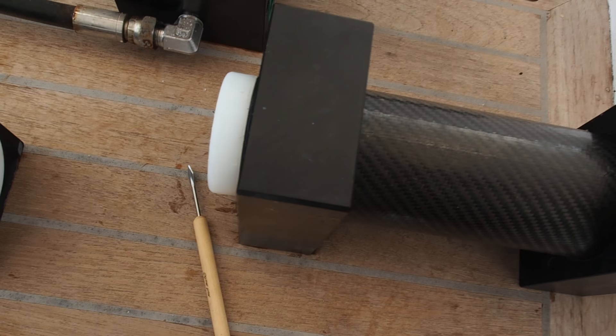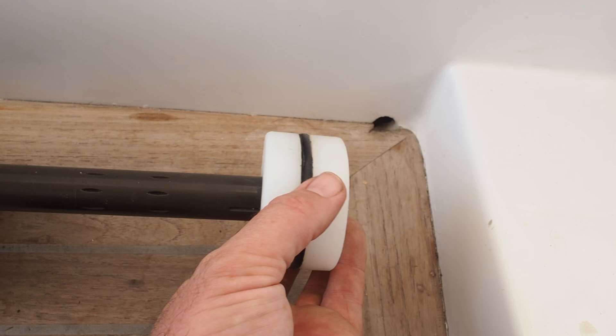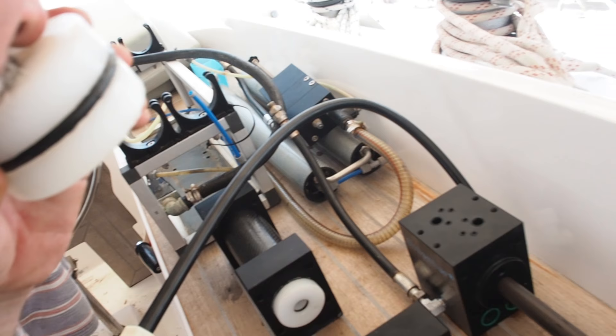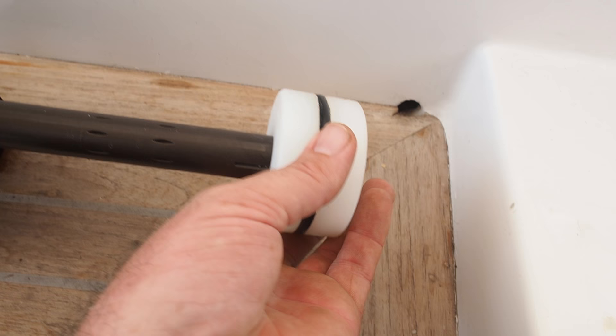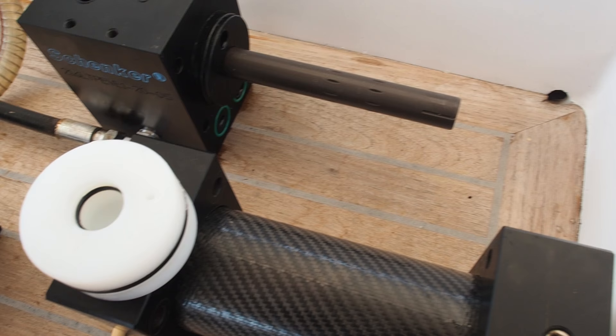Phil's arrived and we've been working together. According to the instruction manual, to put the pistons on the rod, we need to purge any collected air. However, these appear to be a newer design — they have a hole drilled in that releases air when you blow into it. The new piston also has grooves cut into it so any excess air is purged when you push it on. So we believe we don't need the fishing line trick — wrapping fishing line around, popping it on, then pulling the line out. We think we can just pop them back on.